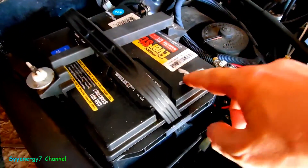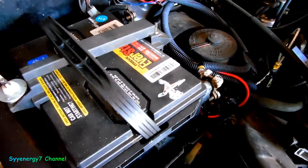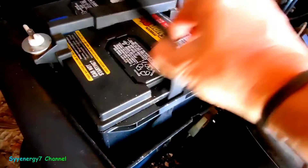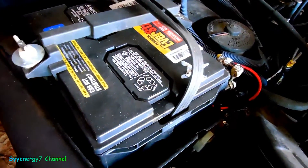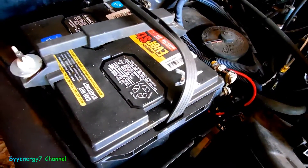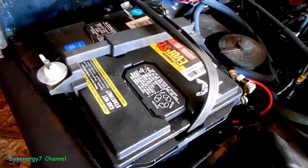I always mark my batteries like this with a big X — I put it on with white nail polish so it doesn't wear off that easy. So I know which side is positive. I do that on all my batteries because sometimes at night you can't see what's going on and you want to make sure it's hooked up right. After you did a good charge on it — better off having these type of batteries. I'm gonna check the water and put distilled water in it, probably okay but just double-check it. If the water gets below the plates you can cause some damage.